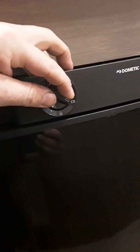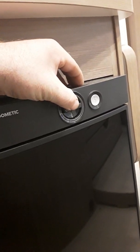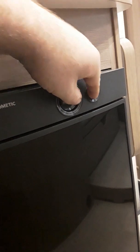To turn on the gas, turn on something, click there. Hold this button in, this opens up the gas valve. This also controls your temperature of the fridge. Hold this button in and press this in. You will see the wee red line climbing up onto the green.